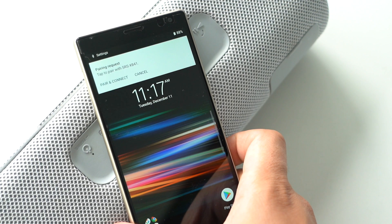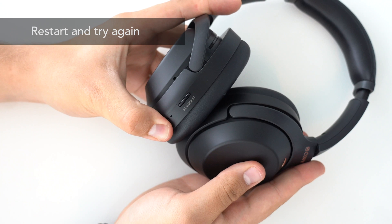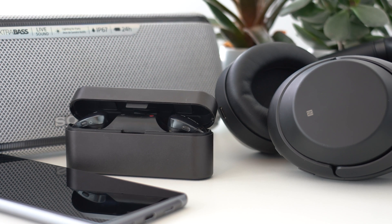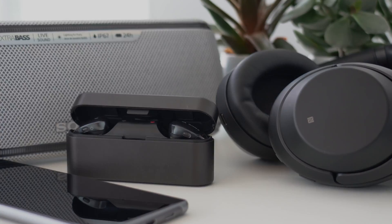Using NFC could also be an alternative course of action, if available. Restart both devices. In the first episode of this series, we explained that exchanging pairing information is like establishing a friendship — sometimes people start off on the wrong foot. Maybe your devices did too. Try turning off and restarting both devices and try again. While it may sound redundant, this solution will actually resolve the vast majority of pairing and connection issues.